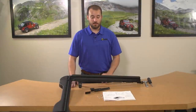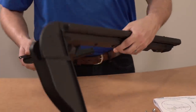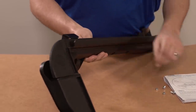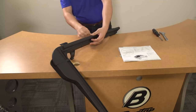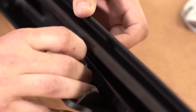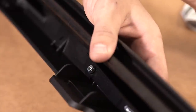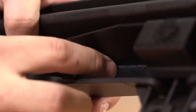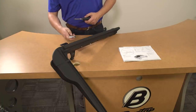In section one, step one, you'll be installing the cable guide bracket into the rear door surround — this one is for the right side of the vehicle. You'll need two M5 screws and two M5 lock nuts to install the cable guide bracket into the door surround. When installing the cable guide bracket to the door surround, the screws should come in from the bottom. Once you've got the screw through both the door rail and the cable guide bracket, you'll start your lock nut by hand on both screws. Then use your screwdriver with a number two Phillips bit and your adjustable wrench to tighten those screws all the way down.